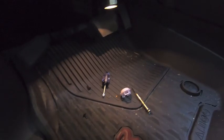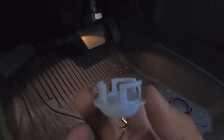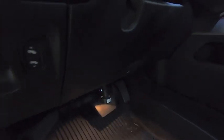Now let's focus on the footwell lights. I'm not really sure how these come out, so I'm going to take an exploratory look. Here's the light - I already took the lens off. There's a Phillips head screwdriver that pushes into a clip, and once you undo that the light hanger just pops down and hangs above the wire. Then you twist it around - this is the little lens that goes on top, and you just carefully pry it straight up out of the holster. That thing is blazing hot right now, so I'm going to let it cool off before pulling the bulb out.